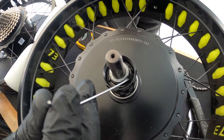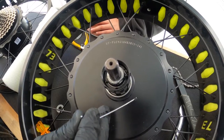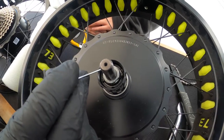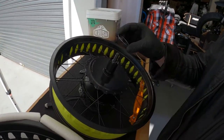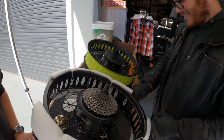As you can see on this wheel, the bearing shield has been crushed — hence why there was a clicking noise coming from the rear wheel when riding. Don't forget the spacer underneath the cassette, because it will be annoying after assembling the cassette back on the new hub.